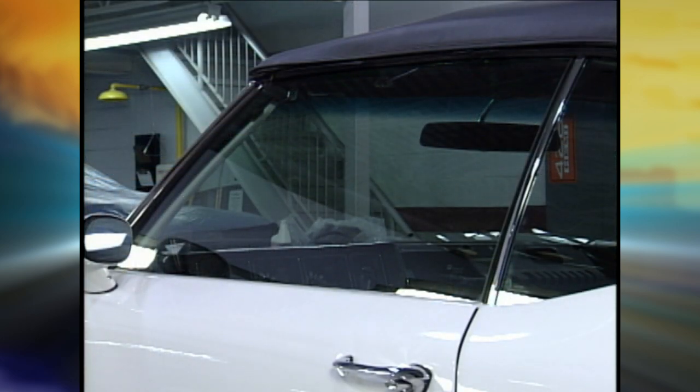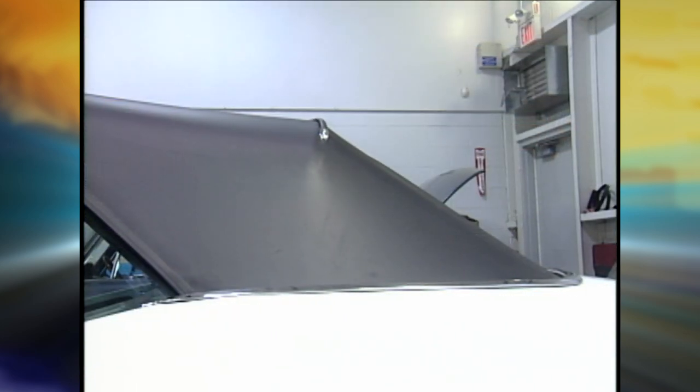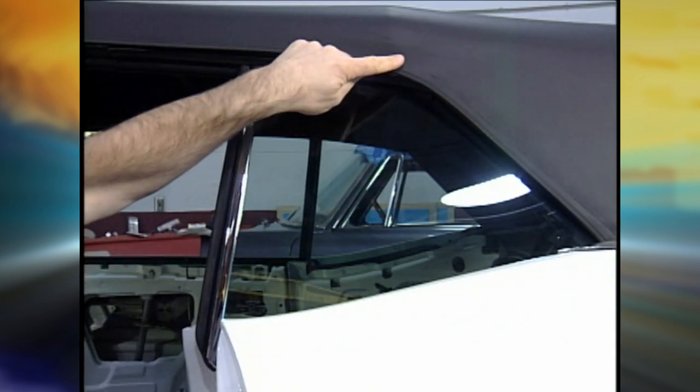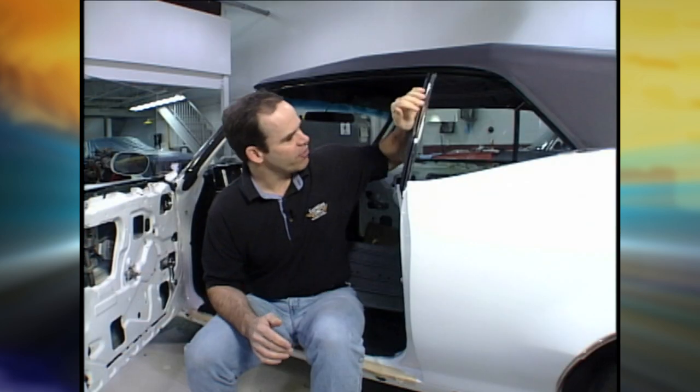There's an order to do things in. First, the door to the quarter panel has to be fit to the fender. Second, this car being a convertible, we have to get the convertible top done — Gary at Diamond did that and did a great job. It fits in there nicely. Now we've got to adjust the glass to the convertible top. We're going to start at the back and adjust to what would be the C-pillar on the convertible top, making sure it fits in there nicely.